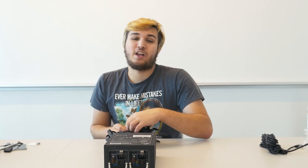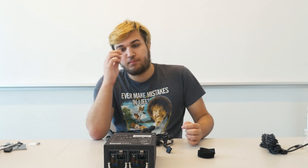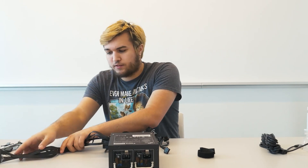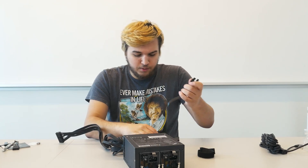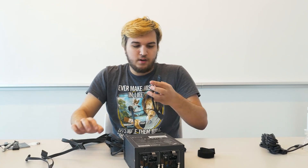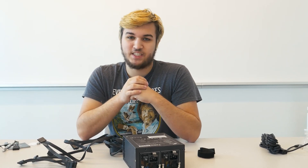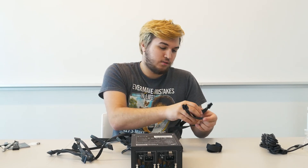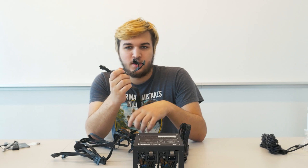In case anyone's looking for one of these, I will have them linked in the description below. I did check the website before receiving this unit to see what kind of connectors I had so I could plan out my build, and it has a very good range. We have our 24-pin, naturally. We have one Molex and SATA chain — two Molexes and two SATAs on that one. Then a full SATA chain with four more SATAs. SATAs are very important for this storage server. We have two 8-pin CPU connectors, our USB header, and a 2x6-plus-2 GPU connector.